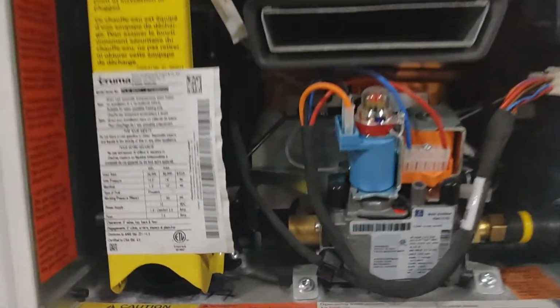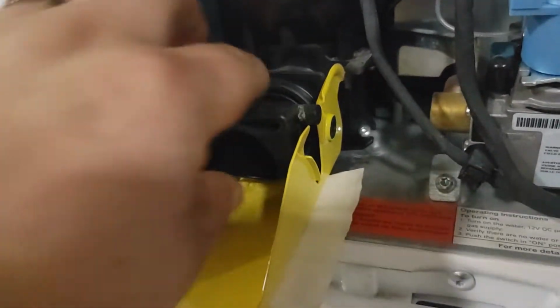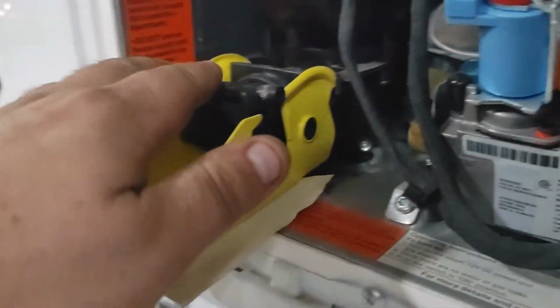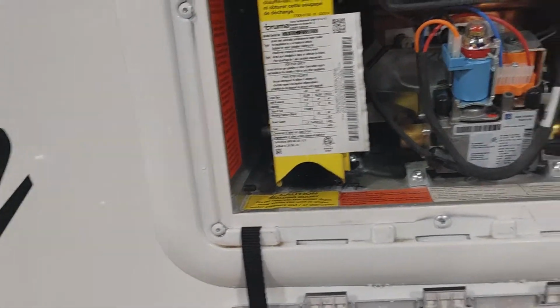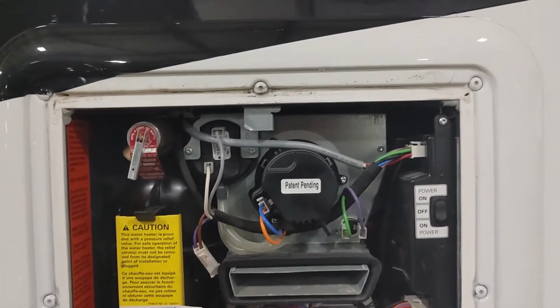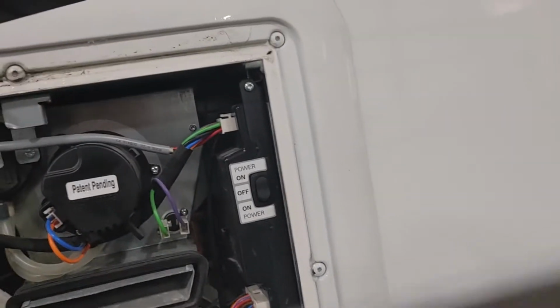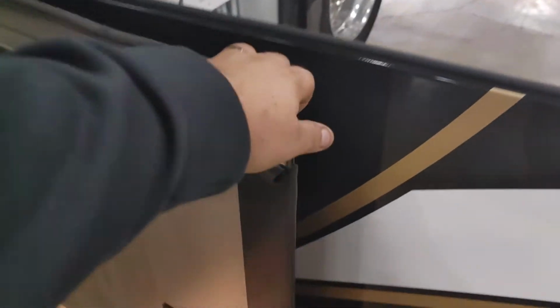But beyond that, the drain here probably has a little bit of water in it. Oh, a little bit. Pull that. You have your plug there. Just make sure you drain that during the winter, or even if it's going to sit for a month or two, or a week or two even. Just drain it. Big one on that. But you can leave this on when you're camping or just driving around. Always close the back door first on this double door, and then the front door.